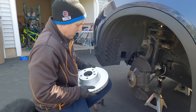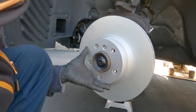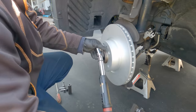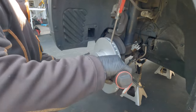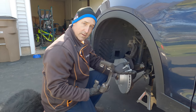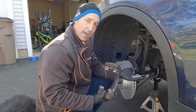Here's the locator. I haven't done anything with the surface of this rotor — just line it up and it will usually stay in place with a little light pressure. Take your locator and get it started. The torque spec on this is just 16 Newton meters. Use a screwdriver as your counter force. This is a one-time use bolt — do not lubricate it, you want it dry.